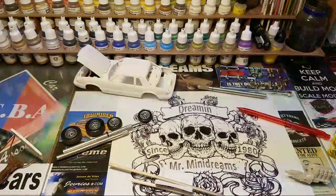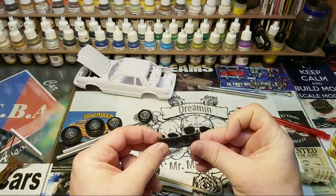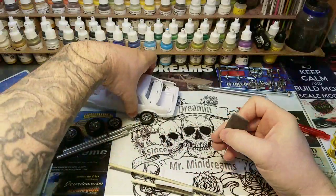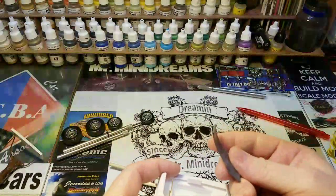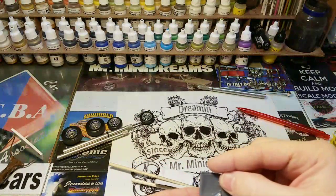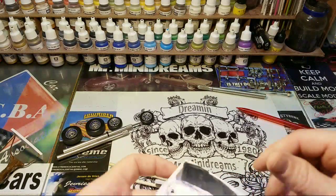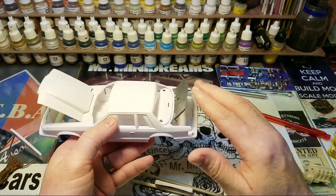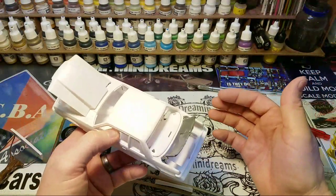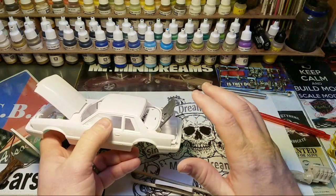And to back that up, I take two rods that I use to hinge, I put tape around them, and then those will go on the hinges to keep the hinges from getting damaged by paint and stuff. And I got a bunch of different sizes of that to fit different hinges, so that way now I can paint my car. Just some cheap, quick tools that you can do.